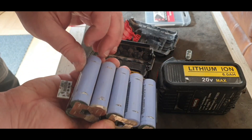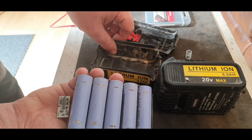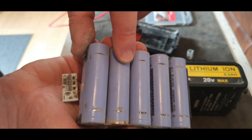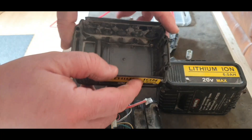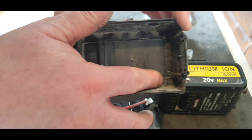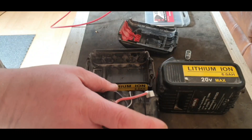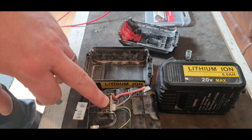Other than that it's not very bad. What I don't like — and here's a terrible thing — if you look at that, you can see the cells have actually been rubbing the bottom of the battery box. The things that hold the cells in place are actually sharp, actually cutting into this. Over time, could that puncture a cell? That would concern me greatly. I've heard of knockoff batteries catching fire and I'm wondering if this is why.